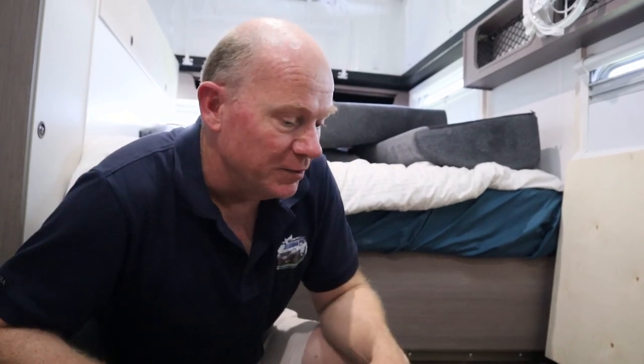Max Caravans installed the 3,000-watt inverter for me. You can't run the inverter through the existing Projecta battery management system to monitor what it's doing. So I wanted to leave the Projecta in because it's running perfectly and running everything. I wanted it to be as simple as possible, that's why I've got the iTech World screen up there which I'm now using - it tells me what's going on. I've had to put the shunt directly onto the battery, and the Projecta obviously isn't reading that shunt. It has its own shunt but it's not big enough for what we want. So hopefully that makes sense.